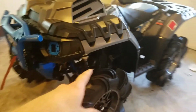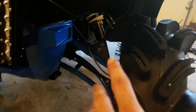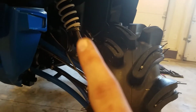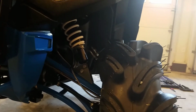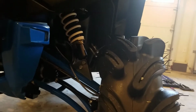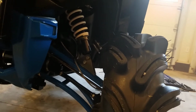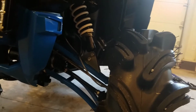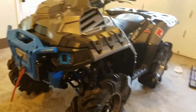Got the 2-inch Highlifter bracket lift. To be honest with you, it's really about a 3-inch lift with the preload turned up on the springs, and it really rides the same as it did before, because the Highlifter editions have a little bit stiffer springs in them than the stock ones. We got it powder coated the same color gray as the plastics, all that kind of blah blah.